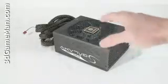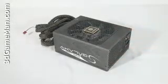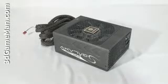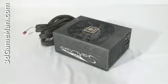There are a couple of important things to remember when selecting a power supply. The first is wattage — determine how much wattage you're going to require by the amount of hardware you'll be installing. Generally speaking, a medium to high-end gaming rig will require a 500 to 700 watt power supply. For a hardcore system, select a power supply around 800 watts. If you're building an extreme gaming rig with a top-of-the-line multiple video card setup with lots of other hardware, select a power supply that's 1000 watts or greater.